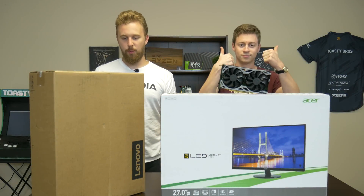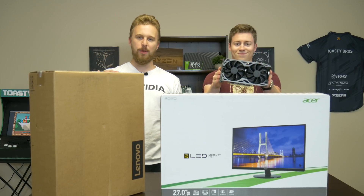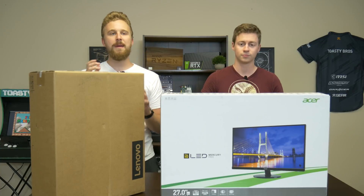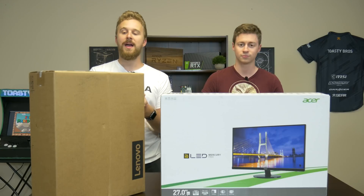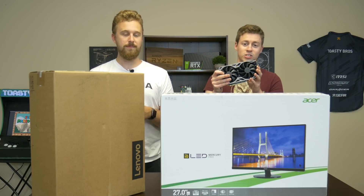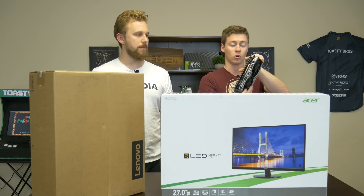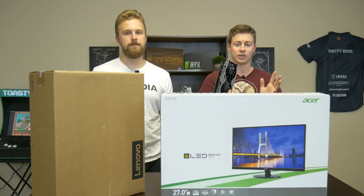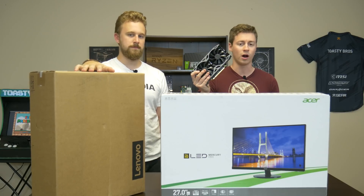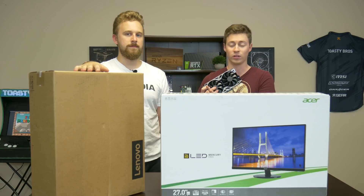We are back. We took a quick trip to Best Buy and got a Lenovo tower with an i3-8100, 8GB of RAM, and a 1TB hard drive — a basic pre-built at $369. We're going to be upgrading it with an EVGA GTX 1650. The only downside with this particular card is it requires external power. Almost any other 1650 we've seen does not require external power, but we can adapt it in this build. It uses about the same wattage, so it's not going to consume a bunch more.